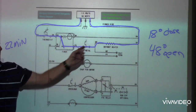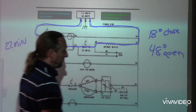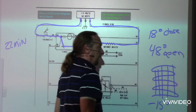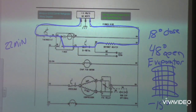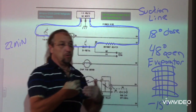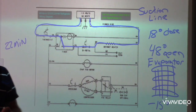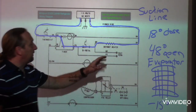This thermostat is attached to the evaporator tubing inside the freezer. What temperature do we say that evaporator gets when it's running? Negative 15 degrees. That's about the approximate temperature of an evaporator inside the freezer. Does anybody know what tube in the evaporator the bimetal is usually attached to? The suction line — very good. The evaporator has two lines: one is the capillary tube which comes in and feeds the evaporator, and the suction line is the one that comes out. The bimetal is always attached to the suction line, sensing the temperature of that tubing. So when it gets about 18 degrees, this thermostat will close.